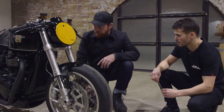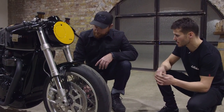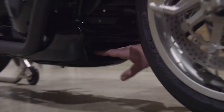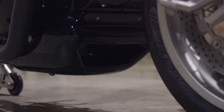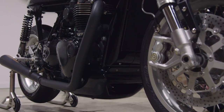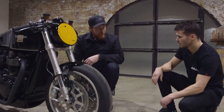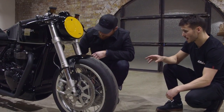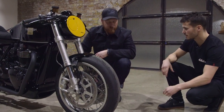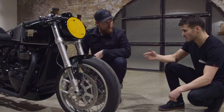The stock rad works well — it's just about dressing it better, losing what we don't need and dressing up what is there. The belly pan is functional, not just decorative — it's channeling air up underneath to help cool the engine. There's no cat anymore. With the new Triumphs that part of the frame is very wide to accommodate the cat, so without the belly pan they look a little odd. The belly pan covered that up while also adding to cooling and styling.